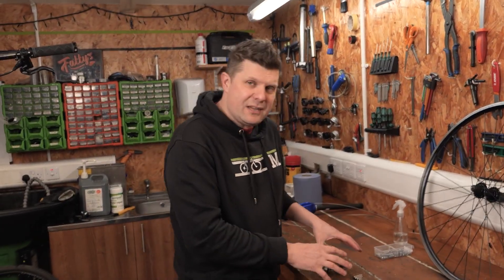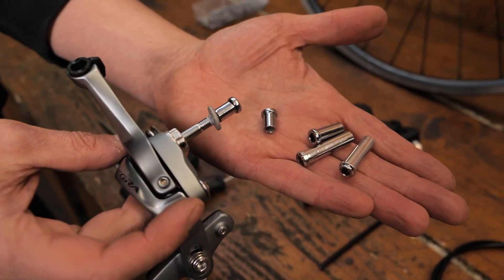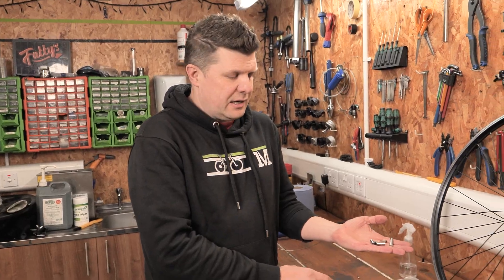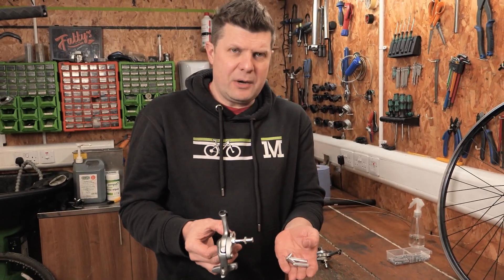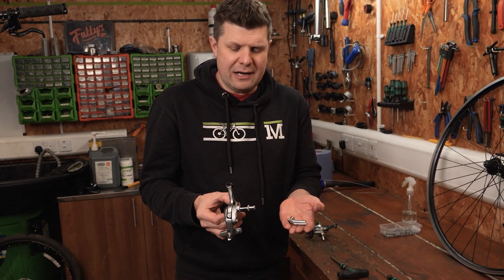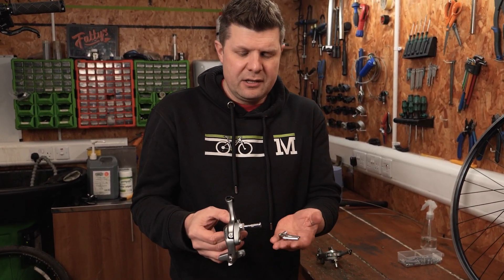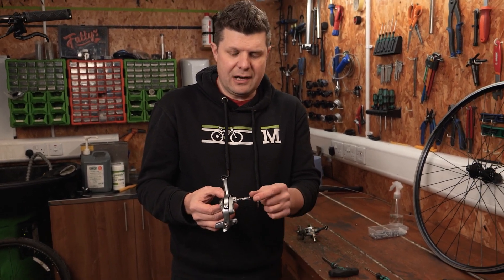When we come down to actual calipers, a lot of people don't realise how important the length of the brake bolt is to actually hold the caliper on. When you buy them brand new, they're normally supplied with a little pack so you can choose the right length. If you buy second hand or switch from one bike to another, you might need to buy a pack of bolts and get the right length bolt.